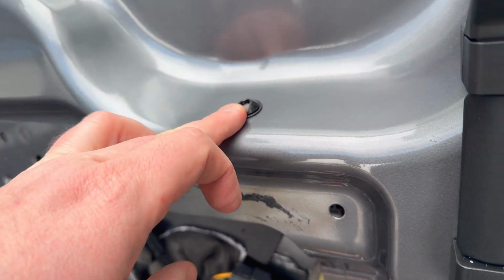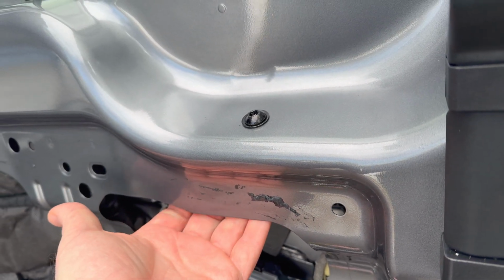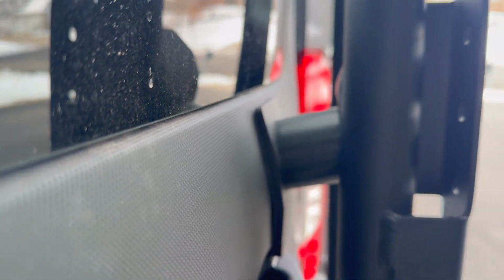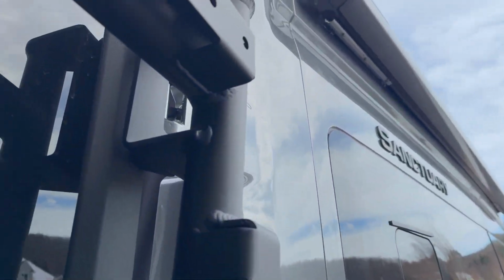These bolts are getting tight now too. You don't have to over tighten any of this, honestly. You just have to get it just snug and tight. Nothing crazy. Don't go wrenching on this and busting any bolts off. You can see I got this tightened down to the point where there was really no air and I can't move it. I can't spin it. But if you compress that too much, that's your spring for when you close the door. So don't over compress that part.